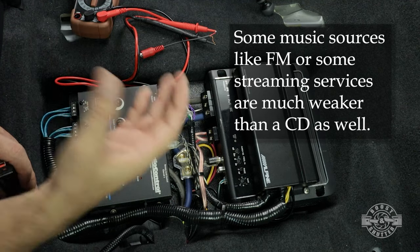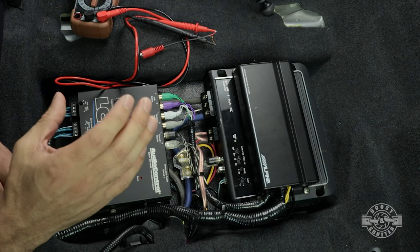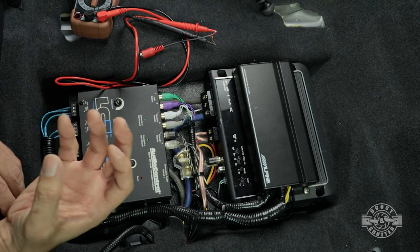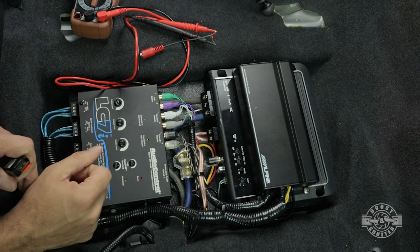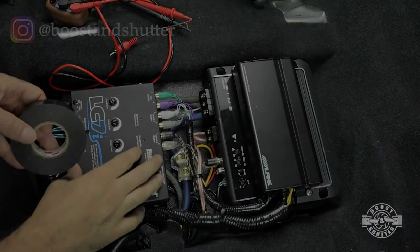Personally I like listening to a lot of 90s music that is not the best quality, and in those cases the music is nowhere near that 0 dB level. So if I'm setting my amplifiers with a 0 dB source I'm leaving a lot on the table — I have to crank up the volume to get that full experience way more than I normally would. Whereas if I set my gains with a -5 dB level, I can actually reach fullness and richness in music at a much lower volume. That's why I went with -5 dB — some people go with -10 dB, but I think -5 is a good compromise.